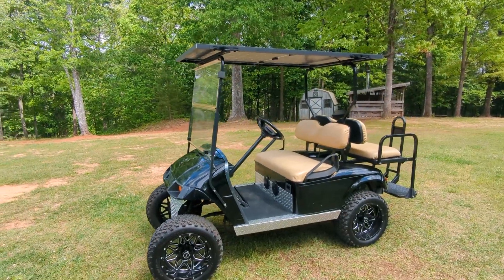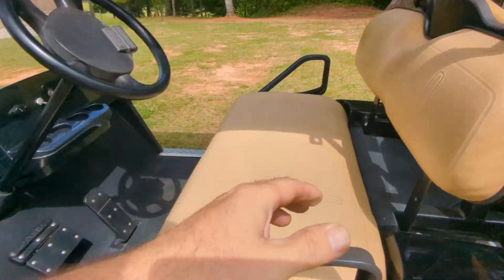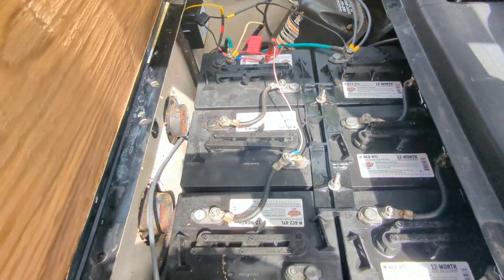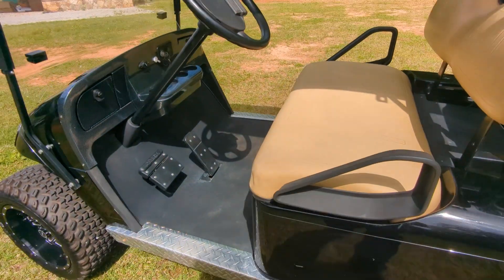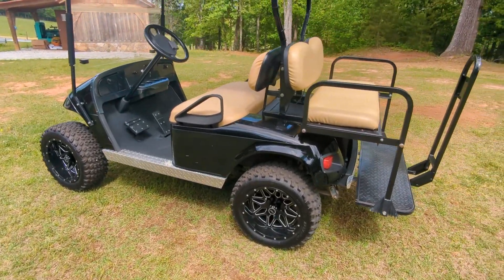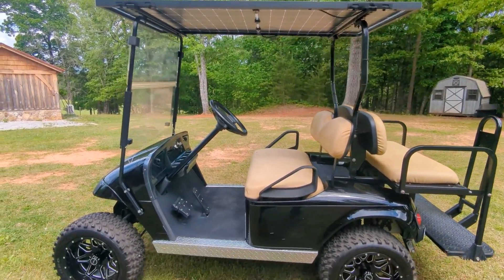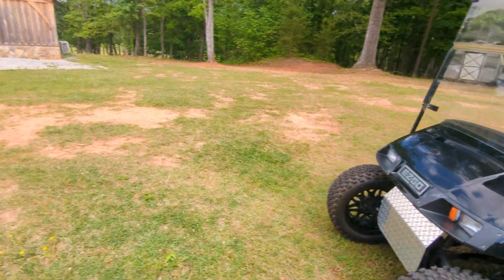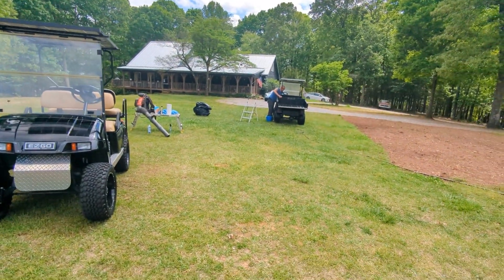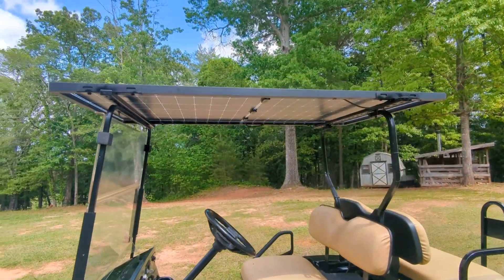Here's the cart I just purchased and refurbished — added the solar panel and the buck boost charge controller. The LED light is solid, battery is full, 36 volt charger working. This cart no longer has to be plugged in. It can charge itself, and those charge controllers do a really good job of keeping the battery floated and in better condition than just plugging an AC charger in. I've been doing this for about five, six years. If you're interested, let us know. This cart we did five years ago, and that one about four years ago — we use them every day. If you'd like your cart converted or want to buy this one, just let us know.